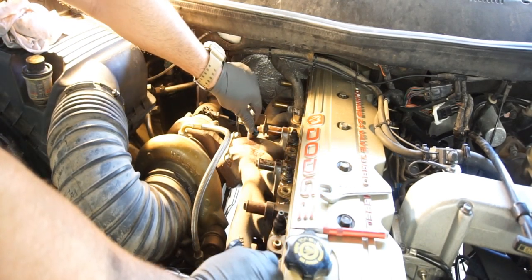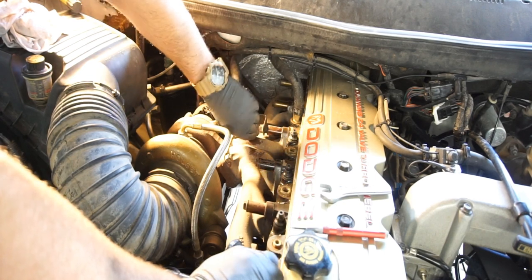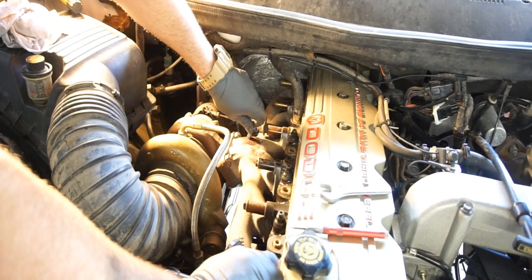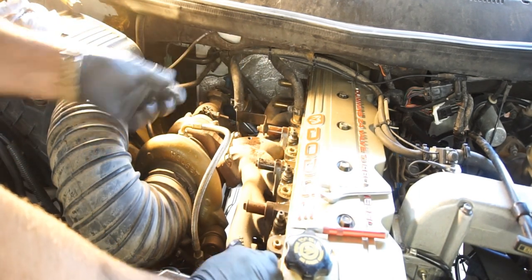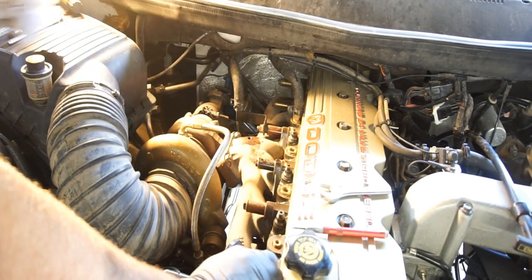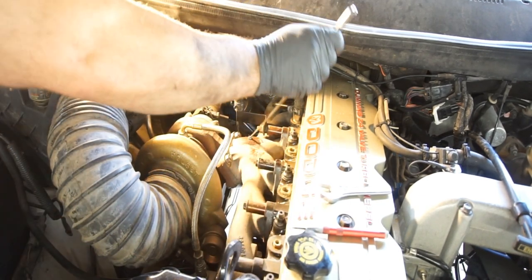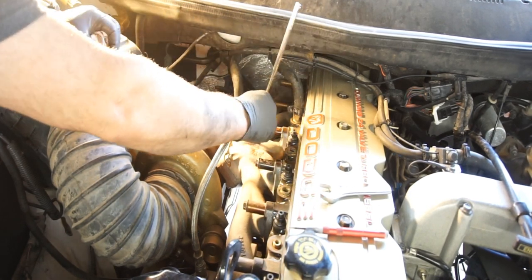So, I tapped it, running it through, did it all with the drill. Hopefully you guys saw that. So now I'm just making sure the threads are clean, which they feel pretty clean. This thread's in by hand. Like I was saying, I don't like to go all the way in and all the way down with the tap, because then when you try to back it out, you're recutting threads. And keep a clean rag. So again, we're going to stick this in there and see how much went in there. If anything, stick it back wherever you can go.